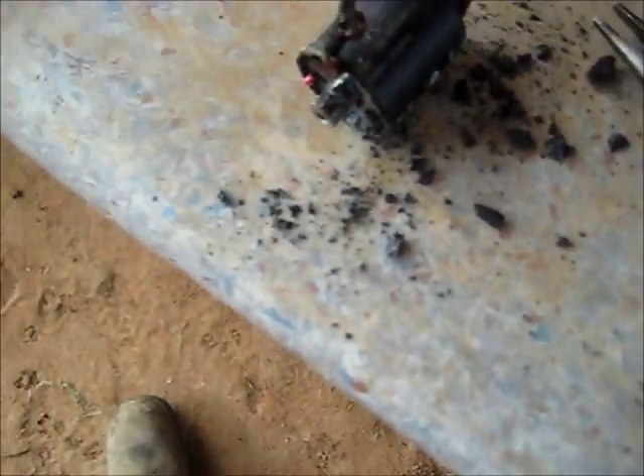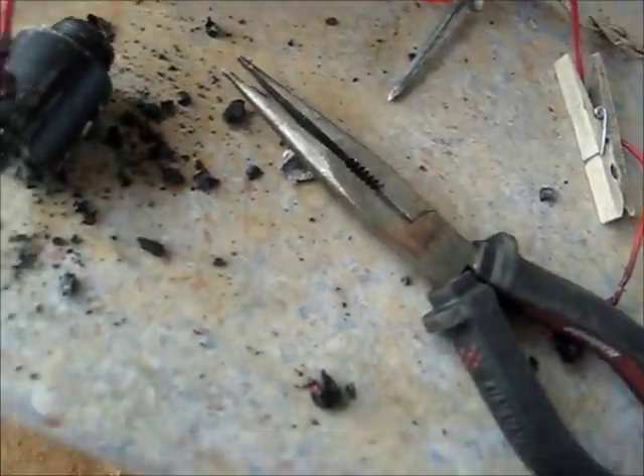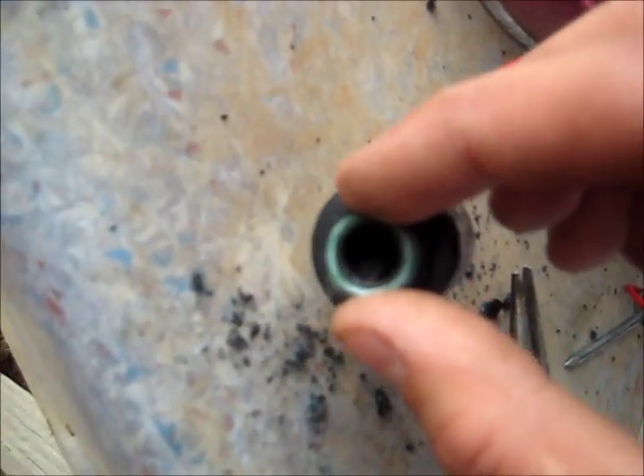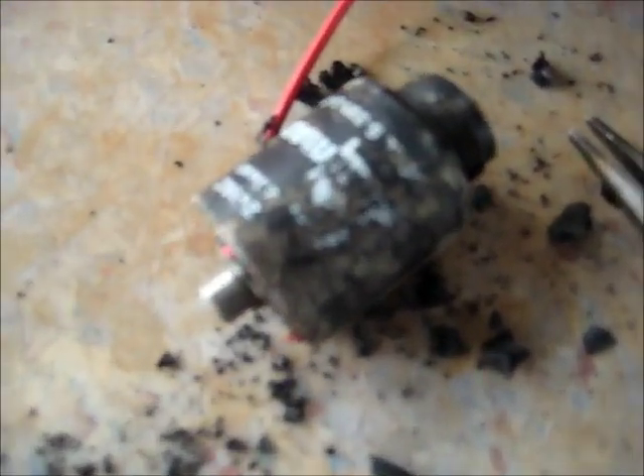So if I can get this epoxy out at the top we'll be able to see the windings. Just dig it out with a nail. I dug all the epoxy out — it's normally rock hard but it turns into butter, soft and rubbery, once it's heated up. There's a cap on there, there's a set of windings in there, and this is a plunger assembly. As you can see, the heat has just caved it all in and ruined it — it's expanded itself in there. Thanks for watching.